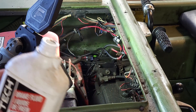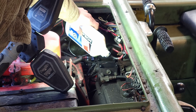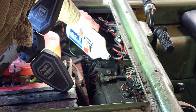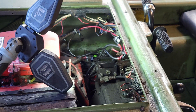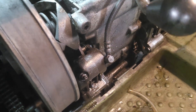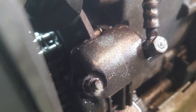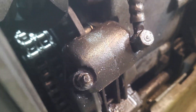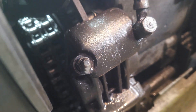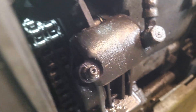I'm going to give this a little bit of a flush with DOT 3 just to get some gunk out of there. Once it runs a little more clear, we'll put the DOT 5 back in. I've actually mostly emptied that top cylinder again. If we take a look at the fluid coming into that bleed hole, it's still pretty milky. That might look like air bubbles on the camera, but it's not — it's what used to be brake fluid. I'll keep pumping at that.